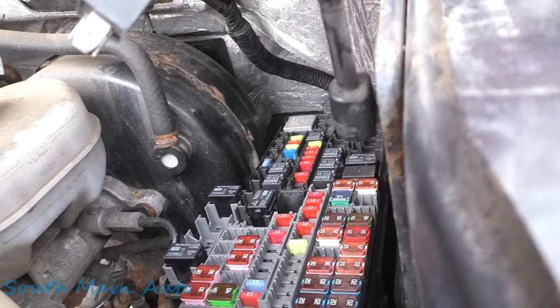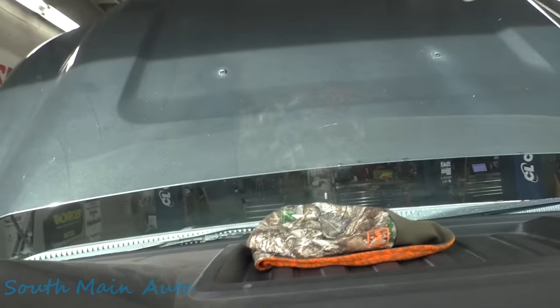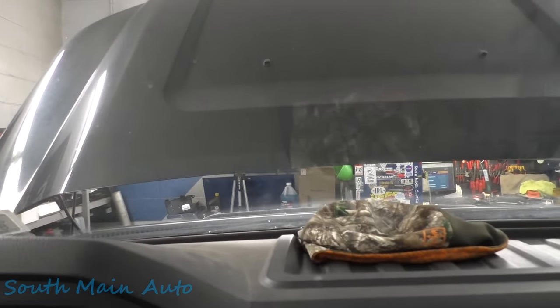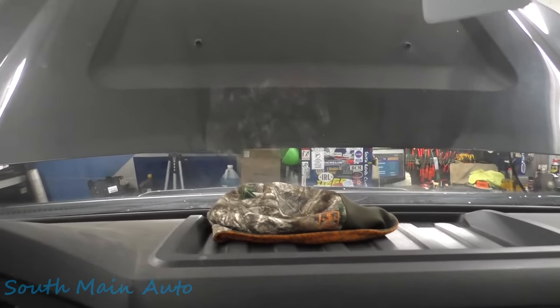There's our relay — let me look down inside that box. So this was kind of weird: I went out and noticed the charging voltage was a little high on the scan tool because we had the battery charger on 40 amps. I didn't leave it on nuclear, just charged at 40 amps. Then I went up to shut the charger off and put it down to a 2-amp setting, and all of a sudden I hear everything light up in the truck. It started! So perhaps was I creating a problem having too high a battery voltage? I've never seen that before — maybe we just got lucky, maybe it's a terminal fitment issue.